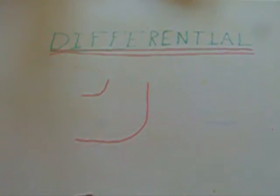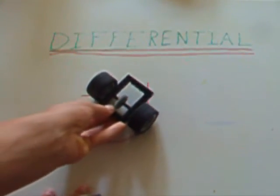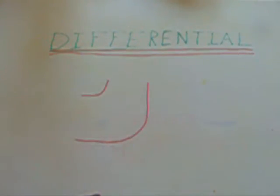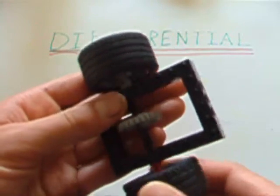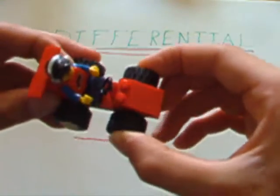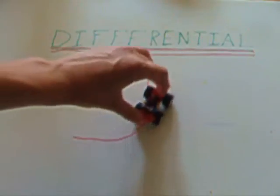Once you're sure you believe me about this binding, let me prove it to you and let me show you how to fix it. When a set of attached wheels turn, as you can see by my little diagram here, one wheel has to turn a much greater space than the other. The outside wheel must rotate a considerable distance more — almost an entire rotation more than the inside wheel. Since the two wheels are attached and the axle can't rotate at two different speeds at once, one wheel must slip across the ground while the other one turns. Think about the first little car that we looked at. It wasn't able to steer perfectly, but that was because of the front steering. The back wheels, since each wheel could rotate at its own rate, was able to steer a lot more easily than our other design.